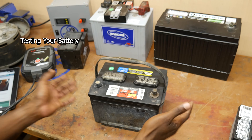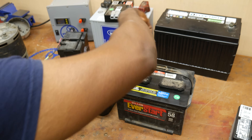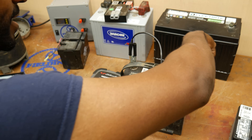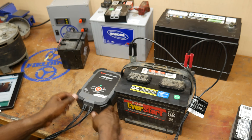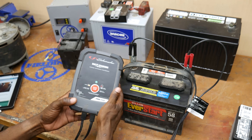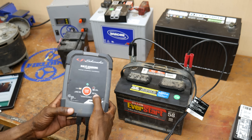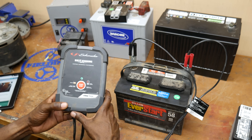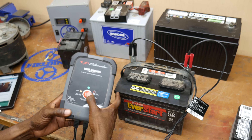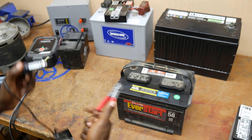Here I have a battery I know is dead. I've got a 12-volt charger, and I'm going to hook it up. If you hook the terminals up backwards, most chargers will just deny it and won't give you a problem, but you do want to be careful. Black on negative, red on positive. Through the magic of editing, I've waited about a minute to make sure it wasn't going to switch over to bad battery, but it seems to actually be trying to charge. I already know this battery won't take a good charge, so I'm going to stop and show you a better way to test it.